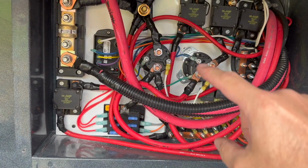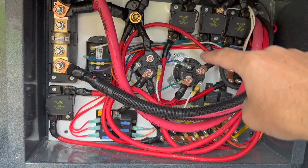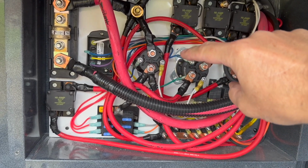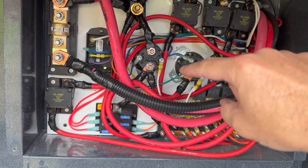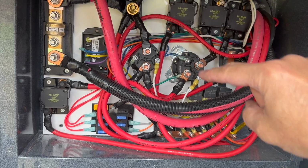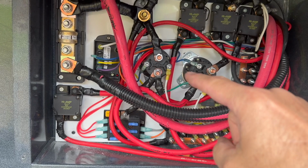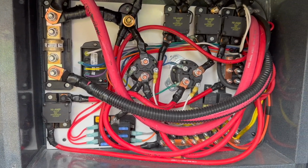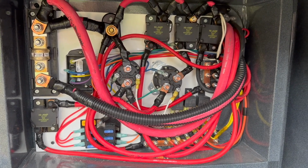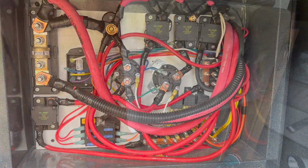The thing with the relay, I got the codes for them. I couldn't get this exact one, but this one, see how the feet are like 90 degrees away from each other? The one I've got coming, the foot's there and the foot's over here. So that's not a big deal. Otherwise, the relay's the same. So we'll wait for that to come in, and then I'll change them out. Hopefully that'll get it working.